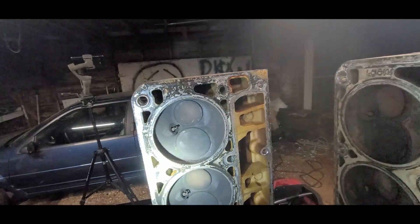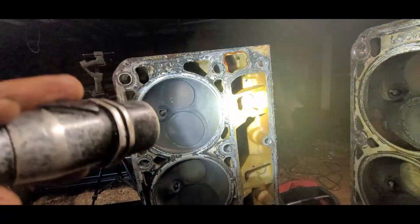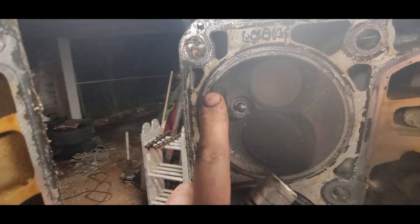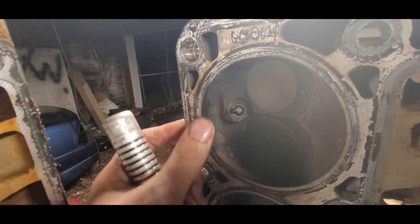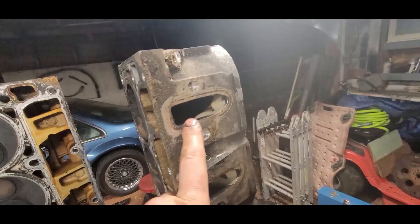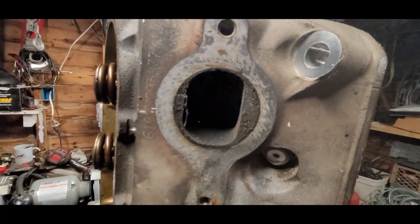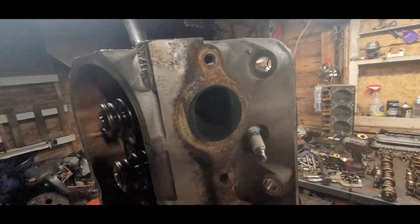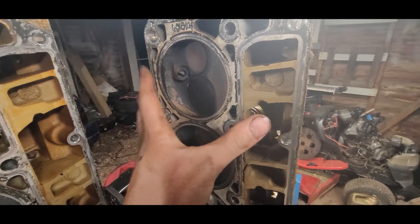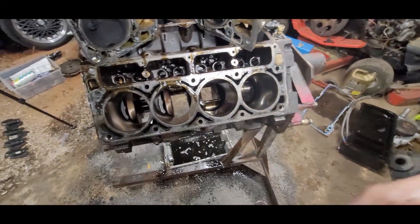For a quick side-by-side comparison, you can see this chamber here is completely cut out on this side — you've only got this kind of flat spot over here. On the 799s you'll notice they have a little bit of a ledge there. I think the valves are different sizes too, but I don't have the tools to measure that here. The exhaust ports look about the same. The main advantage of going with these 799 heads is raising the compression a little bit to squeeze out some extra power. I'm pretty excited about that — especially once it gets a cam on it to juice it up a little bit.